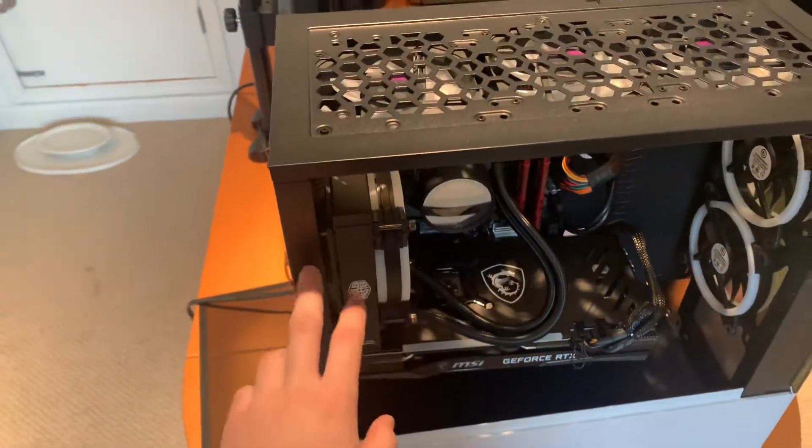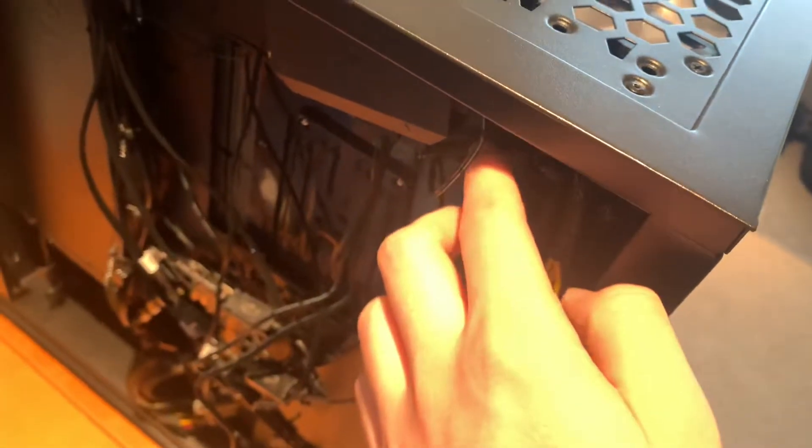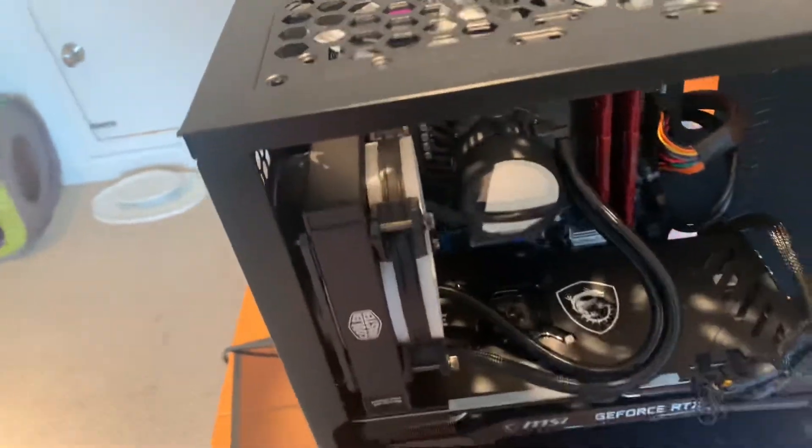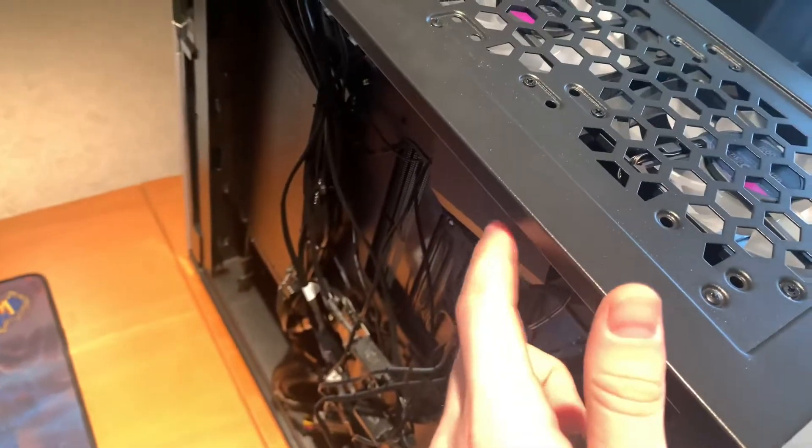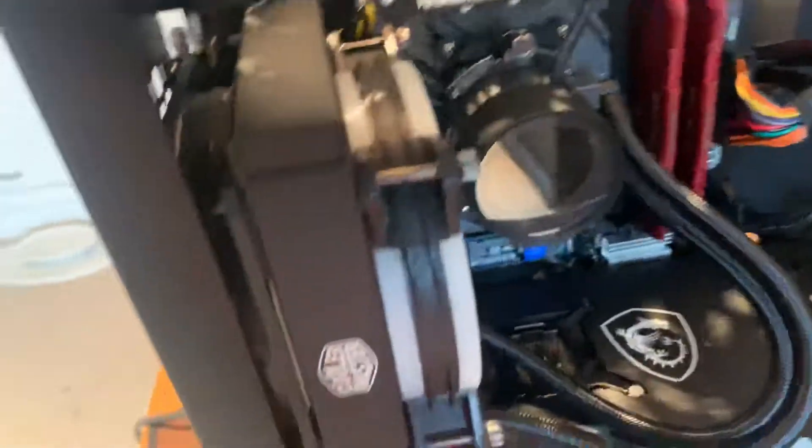It's only a three-prong connector, whereas here it is a four-prong connector. As you can see, that little plug behind the radiator is the chassis fan one port. Initially, what's plugged into that is these two fans and this fan, so this fan and these two fans are connected in a three-way connection and plugged into this cable. So what I did is I unplugged the chassis fan one port that's already plugged in when you first buy the computer, pulled it out through the back, fished it out, and plugged it into port one of this hub. I took the cord I initially had in chassis fan two, which connects these three fans, plugged it into the second port of this hub, and then plugged the output into chassis fan one.